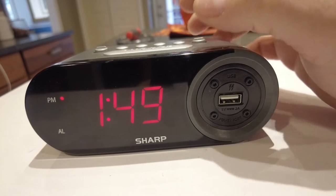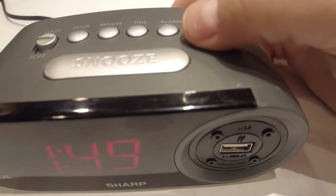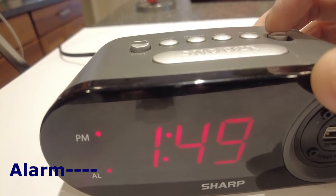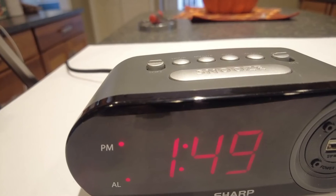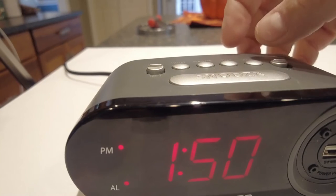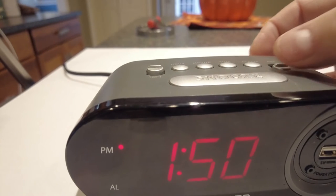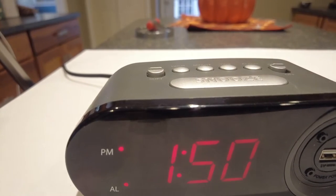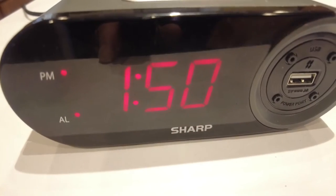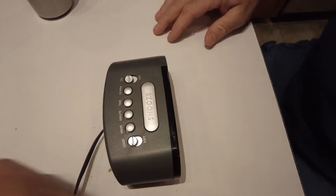The alarm didn't go off again. I want you to pay attention to that little red light — if I bump this a little bit, the light sort of flickers. The alarm did not go off. I'm assuming that's the issue. Let's set it for 1:51, turn it on, and this time don't mess with it. The light doesn't flicker at all, and the alarm goes off. So that flickering light is the problem.